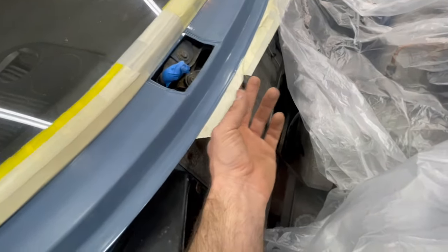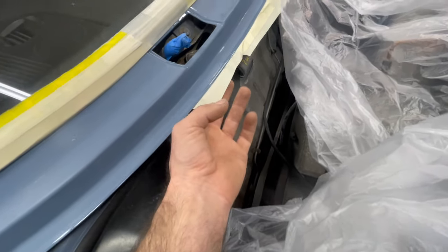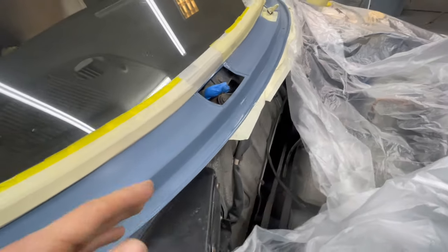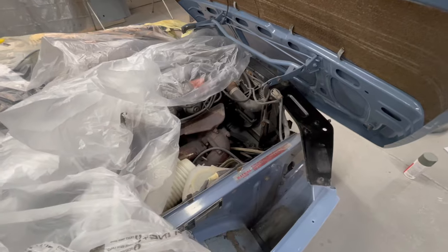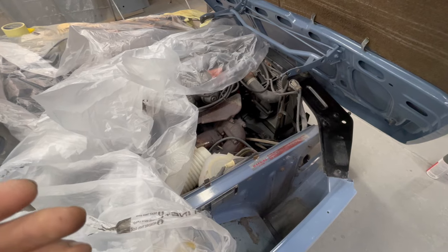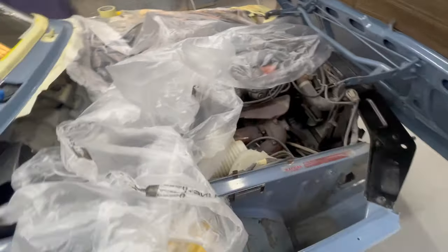A lot of the time you're gonna be putting tape facing up on a seam and back taping it. It helps a lot to do two applications of tape so that it's not relying on just the one bond, and get your plastic and roll your plastic on and cover all the holes. Anywhere that air can go, it's gonna go. And if you have dust all over stuff, that's primer. So what does primer do when base coat or single stage urethane gets in the air? It's gonna bond to it and then it's painted. It's only easy to clean now.